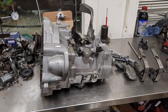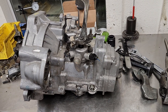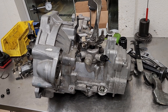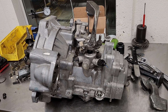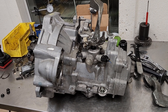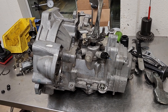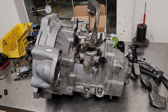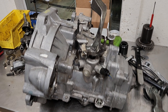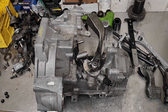I got my 02S 6-speed manual from a 2019 Jetta. The gearing in this is actually really excellent for a Mark 4 TDI - it has the same 3.39 final drive. Fifth gear is pretty close at 0.77 where the stock one was 0.756, and sixth gear is 0.625. The cool thing about this is it's basically the same architecture that the original 5-speed has.